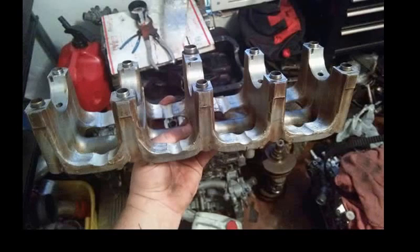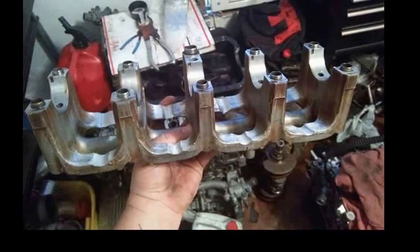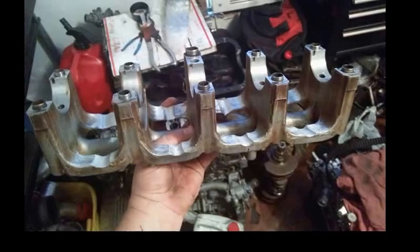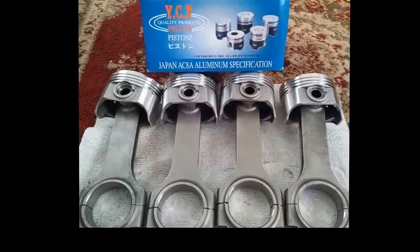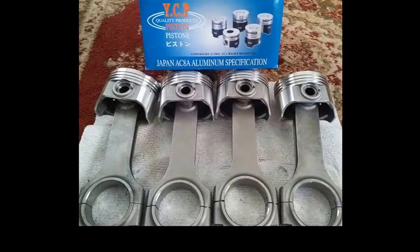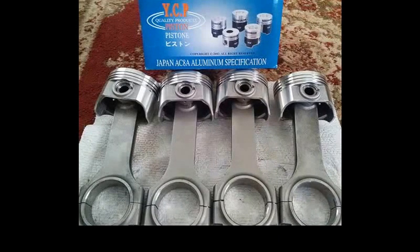Now, I started thinking about it when I heard about it, and I went back and thought about my old B16 setup. It was kind of similar to what he has for bolt-ons, except I had a 35 arm, and at 12 psi I made 334. So that's pretty close for the power outcome, compared to a twin cam 1.6 versus a single cam. And it made me stop and rethink everything, man.